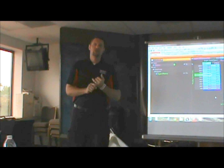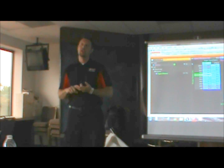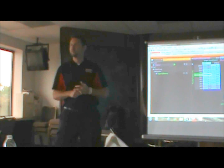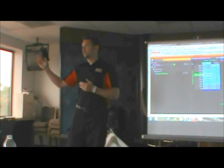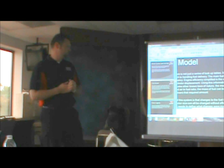You can change injectors, you can change fuel pressure, you can change basically anything inside the fuel system. If you have a fuel pressure sensor on it and it fails, the ECU is going to make the appropriate corrections based on knowing what your static fuel pressure is. All that stuff can be handled without having to go back to the dyno and remap the engine. It also means you can make changes to your bike. Just tell the ECU the few changes you've made and keep going. There's not a lot of extra time, money, and effort that needs to be spent recalibrating everything. Back to the presentation.